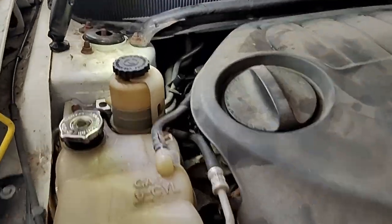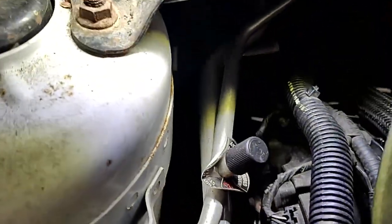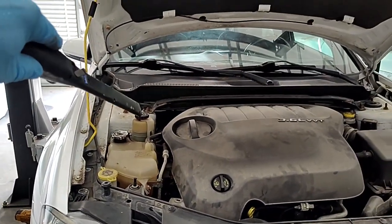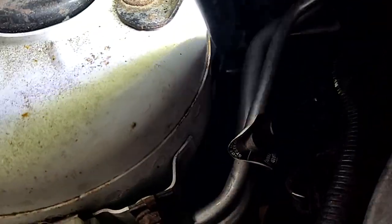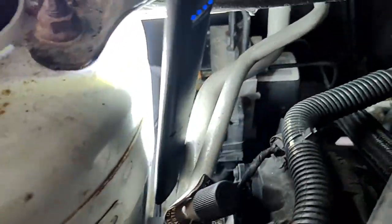All right, now we're up top. You need to unplug that wheel speed sensor now, and it's kind of in a tight spot. If you're looking at the engine, here's your strut tower right here. It's gonna be kind of right beside it, straight down behind these hoses right here, these AC lines. If you look down in there, just jiggle on the wire on the underside where you popped it through, and you'll see it coming through.